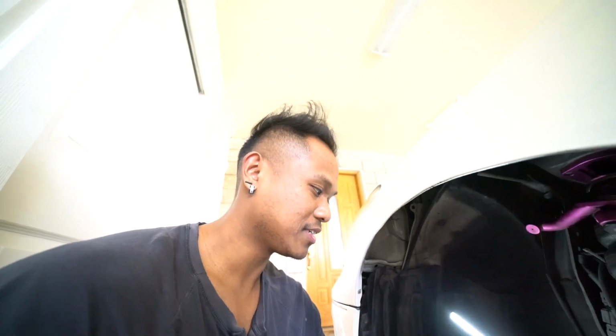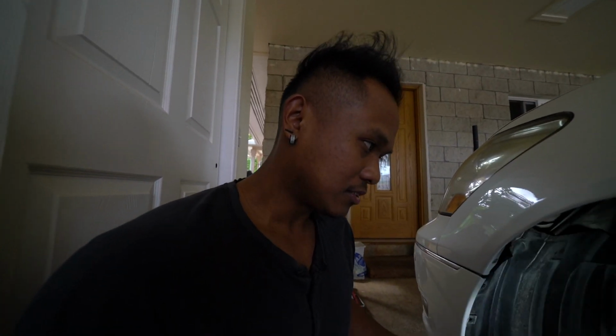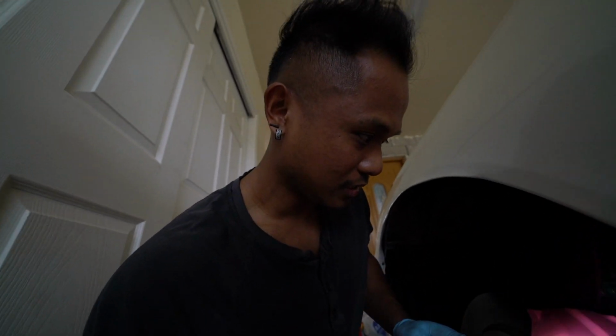Got this side finished up. You gotta check turning clearance after. Undo the other side first, so I don't want anything rubbing when it's at full lock or turning, so I gotta check that too. Going up and down, the air hose is good. Nothing's kinking it, and it goes up and down smoothly, so this side is pretty much buttoned up. Let's go to the other side, finish that up, and then let's get this thing on the ground.